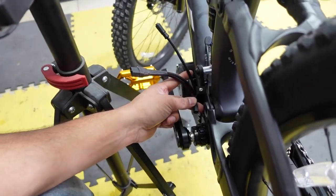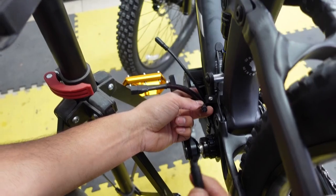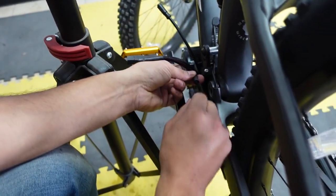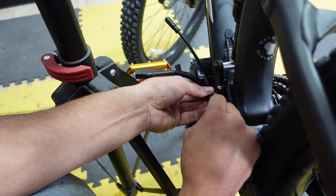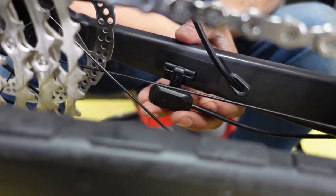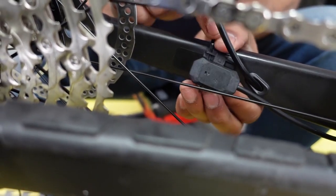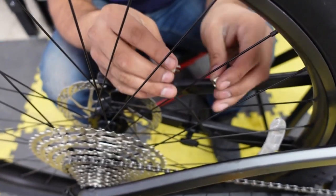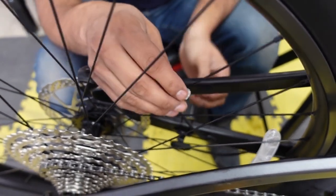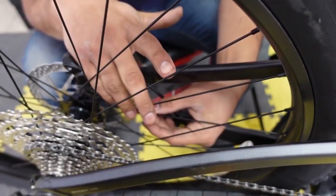Out of the controller there are three wires: one is an eight-pin female plug which is the speed sensor, one is the main wiring harness, and one is for the battery — an XT90 plug. Plug in the speed sensor now. After it's plugged in, put the speed sensor on the chain stay and use the two zip ties that came with the kit to attach it. Install the magnet onto the spokes, tighten it, and line it up with the speed sensor using a flathead screwdriver. You want the magnet to be as close to the sensor as possible without touching it.